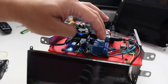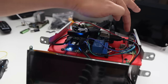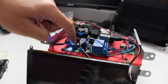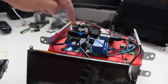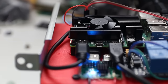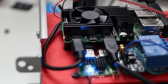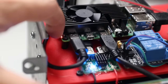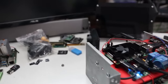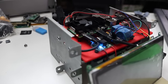Right now the relays are off because power comes from the accessory. Once the accessory kicks in, it will turn on the ESP, and the ESP will trigger the relays. One relay keeps the Raspberry Pi board powered on continuously. There's a red LED on the board — when it's lit the board is off, and when I turn on the Raspberry Pi it will turn off that LED so I know it's running.